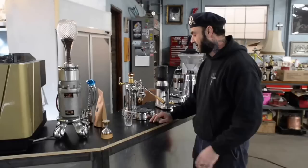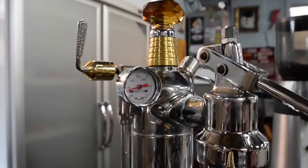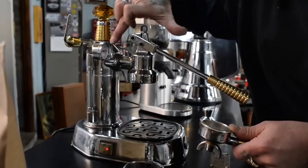I've got a pressure gauge on mine. You can get a kit for any machine through Pavoni — look online somewhere. It tells me when it's at 14.7 psi, one atmosphere — that's when this machine is ready to use. As soon as it's warmed up, before the group becomes the same temperature as the boiler, I'd like to get started.